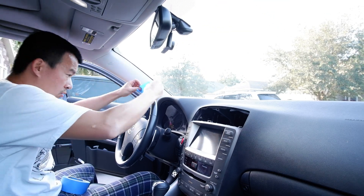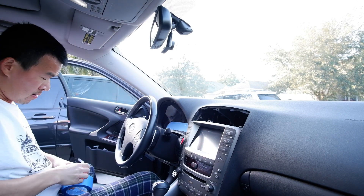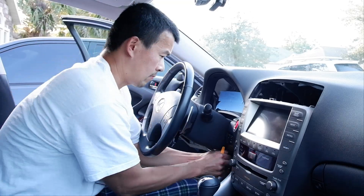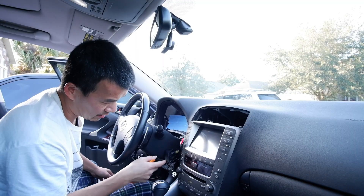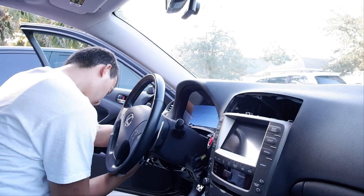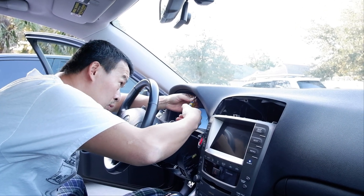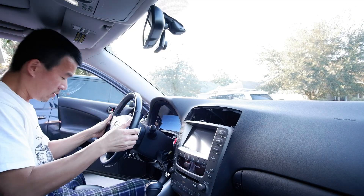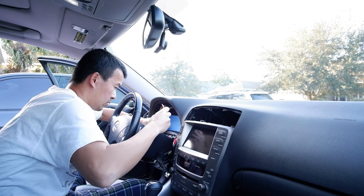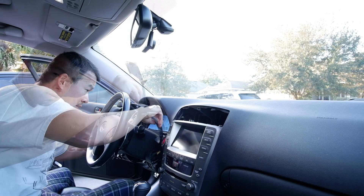Put some painter's tape on your screen because it's very tight trying to get that out past the steering wheel. Mine's pretty beat up from when they changed the dash — they weren't too careful with it. Get the two Phillips screws down here. It helps to have a short screwdriver to get the two little clips up here — unscrew the center of the clip and then pull the clip out. Once you have that, get your panel popper, pop the leather out — there are four little pegs — and then pull this thing straight out carefully.